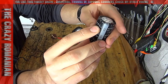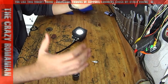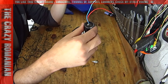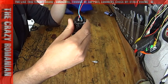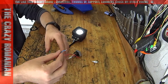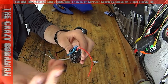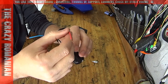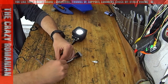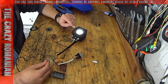This is a capacitor I have — it's 71 volts, 6800 microfarads. What the capacitor does is smooth out the power so that when the LED light drops, the capacitor keeps the current flowing for longer and therefore keeps the light brighter. I'm going to connect the terminals now. I have a blue wire here — it's supposed to be black, it just happened that I had a blue wire attached, but blue is black and red is red. These are connected in parallel, so red to red and black to black.